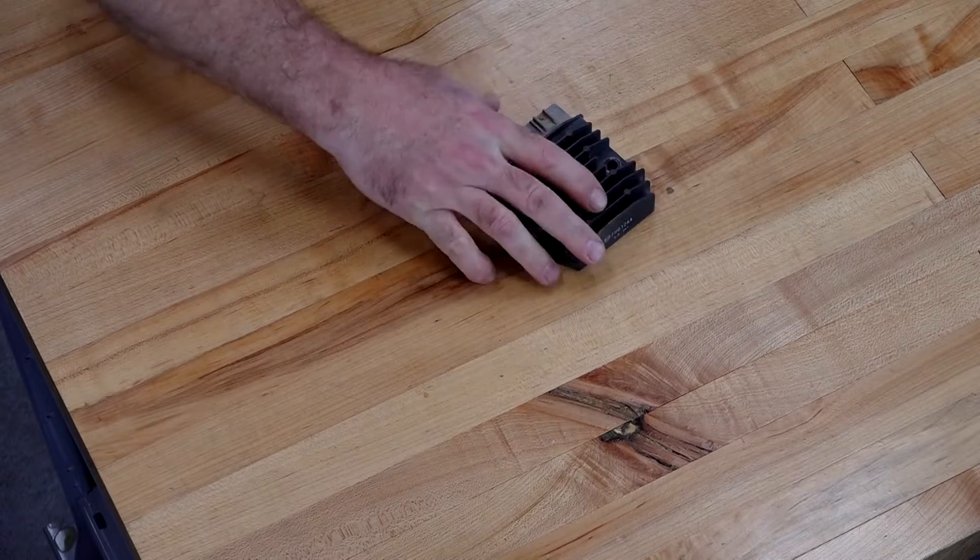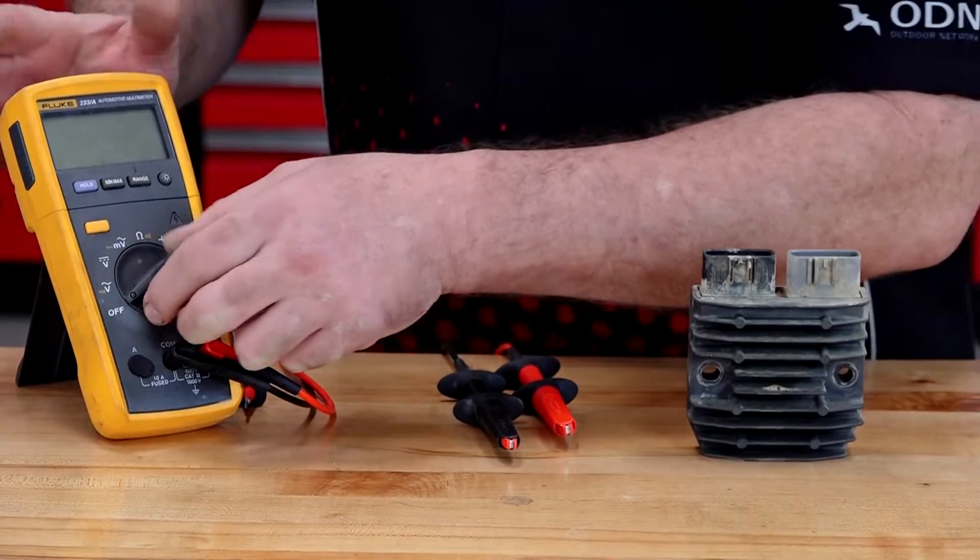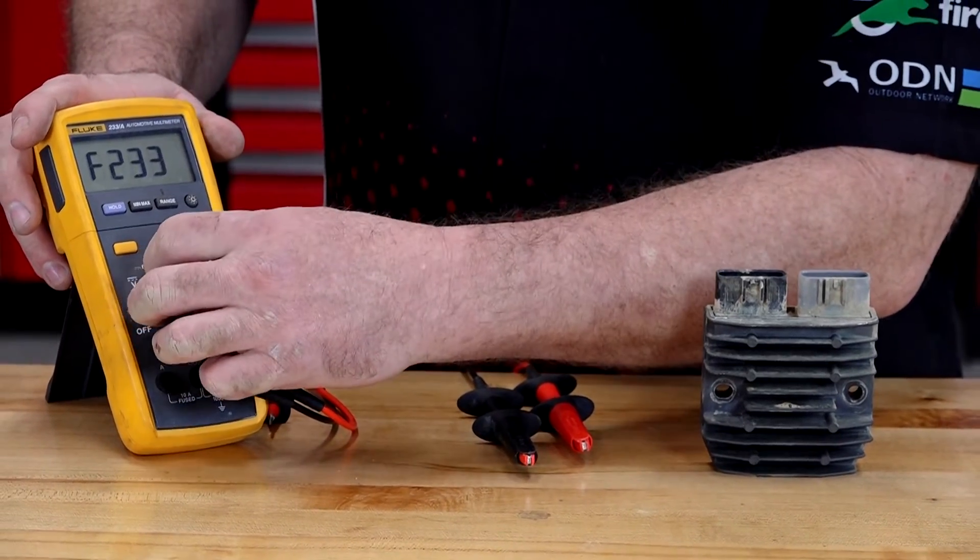Let me show you a picture of what we're going to be doing. You've got a network of six diodes, and what we want to do is check those to see if we can forward bias them on either side. We'll start by putting our positive lead over the negative output of the voltage regulator, then use our negative lead and go to each one of the winding wires — that will forward bias the first three diodes. Then we'll reverse it: put our negative lead on the positive input of the voltage regulator rectifier, and take our positive lead across those same three windings to test the forward bias of the other three diodes. Sounds complicated, but it's really not. Switch your meter over to the diode setting.